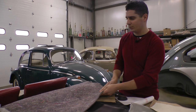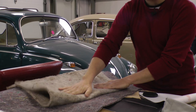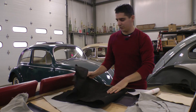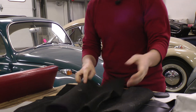If you want to save a few bucks, just buy your own material. This usually goes up on the pillars. You can also get this thicker half-inch jute padding material — we use this to cover seats sometimes — and this goes up into the roof area. Pre-cut kits run about $40 to $60. I just buy in bulk since we're always working on these cars. AutoZone also sells a roll of nappy shag carpet, about an eighth inch thick, for $10 a roll — you can use this to pad the headliner as well.